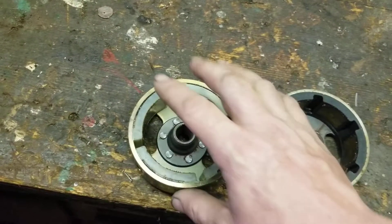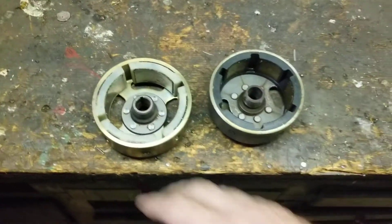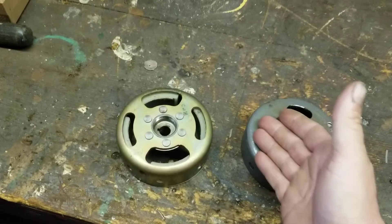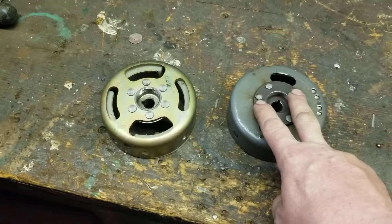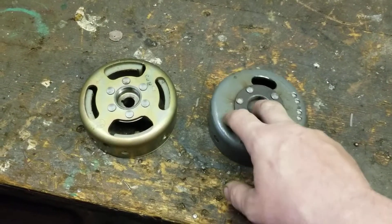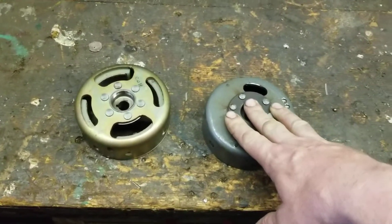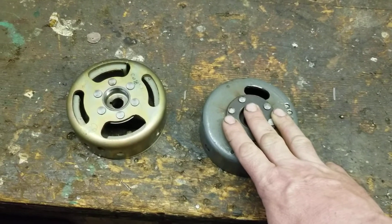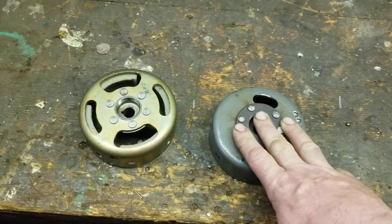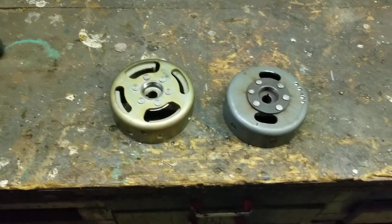The four magnets also have a specific placement — that's the purpose of timing. A lot of people ask: 'I can't find a four-magnet KE100 flywheel.' From 1996 to 2001 they are very hard to find, but they are out there. You have to keep looking. You can go to Partzilla, get the part number, Google it, or call around local motorcycle junkyards to see if anybody has them.